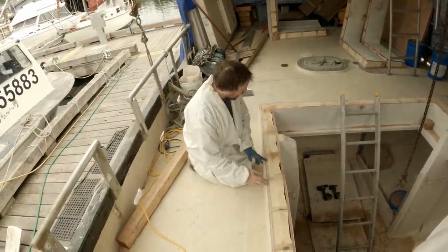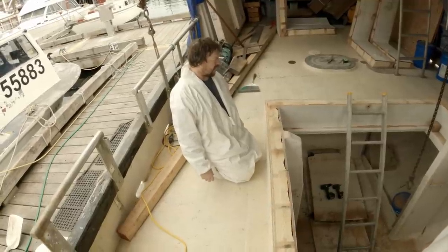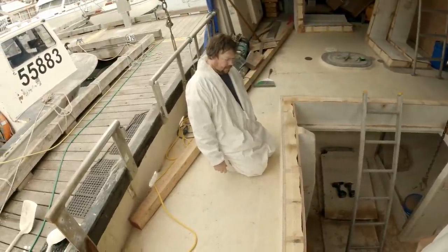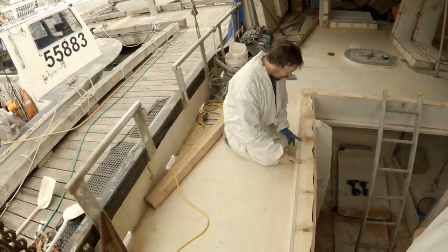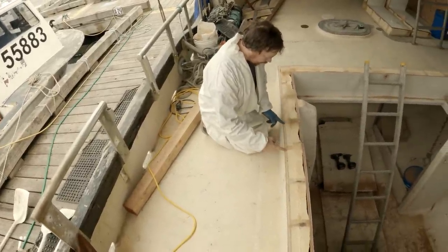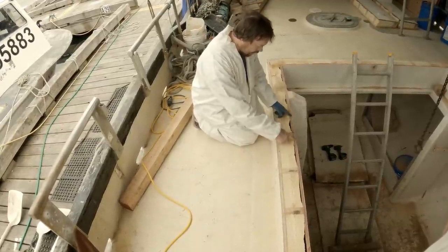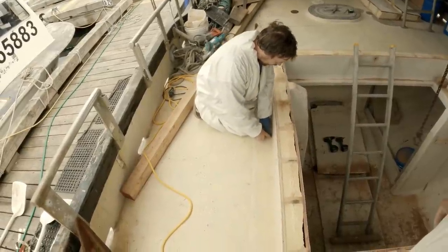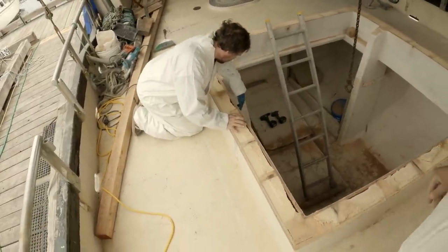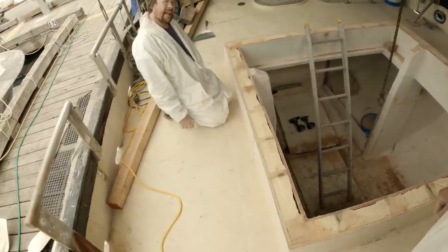Cut it, I suppose. So it's 7 foot now. We're gonna bring it down to about 5 on the inside. Have to do the math so we don't overcut. But we should be okay if we cut it on this side, right? Mm-hmm. So then we can see how this 2x4 is tied in. Cut it down, cut it on the deck here, and then do the same down to here, and then bust that piece off, and then we can take a look in there and see what's up. Yep. That's a good plan.